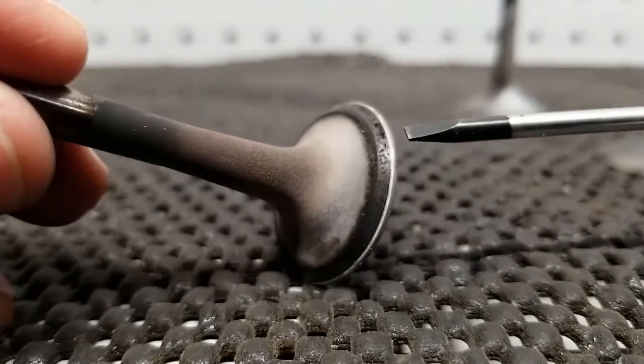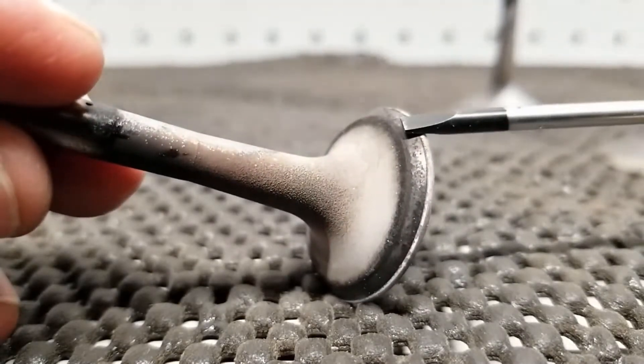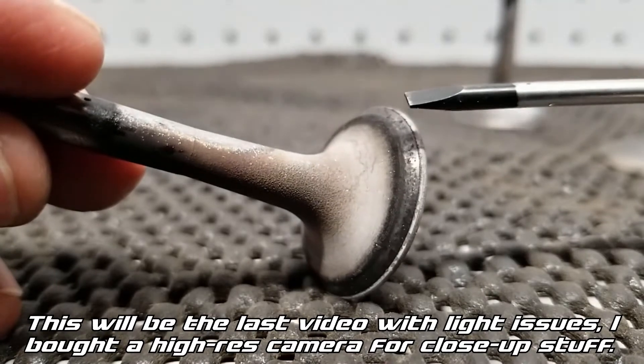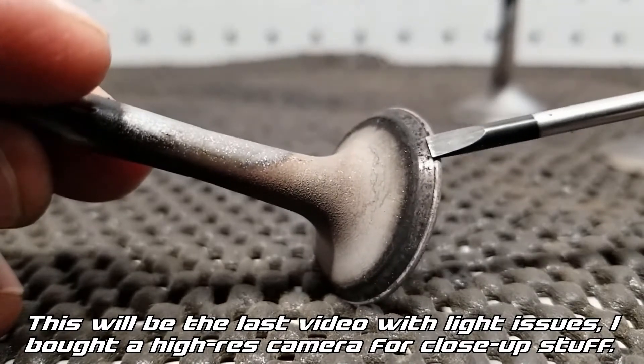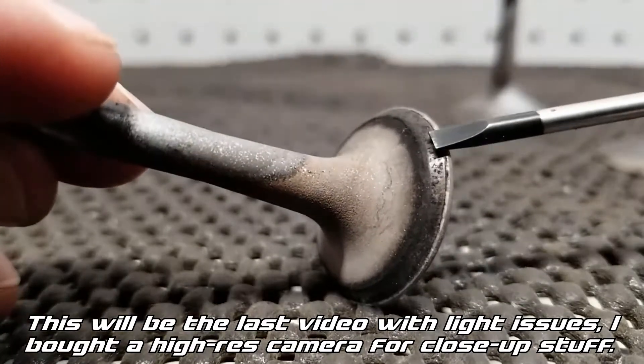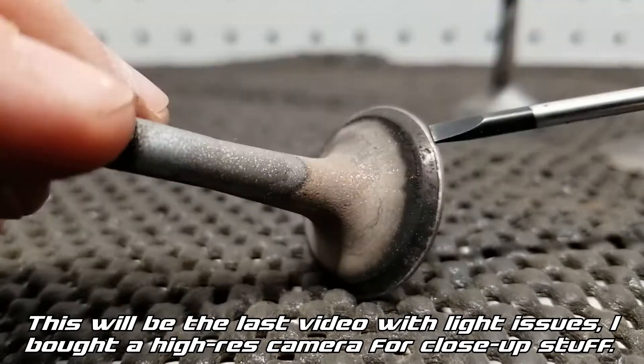There's a chance of a piece of carbon getting trapped. It's one thing for a piece significant enough to break off, but a piece significant enough to break off and then get caught between the valve and the seat, and it hangs the valve for a split second. Then you get crud that embeds in there — like this one pretty much is. That's what we're looking at here.